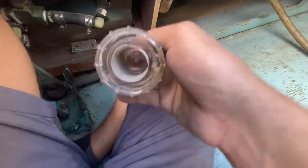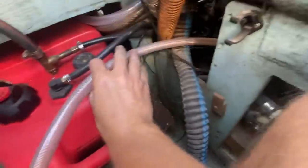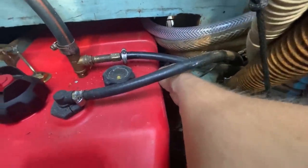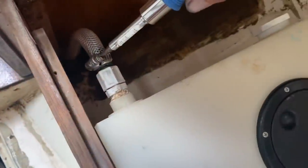There's a little bit of gunk in here — pretty good to clean out. There's the old stuff and the new stuff. I hooked it up and fed it through the engine bay and back underneath the sink toward the water tank. I just barely made that long enough; I don't know if it's even going to fit. Okay — I need to put this hose clamp on here. There we go — that should give me water now. I want to replace a few more lines in there.